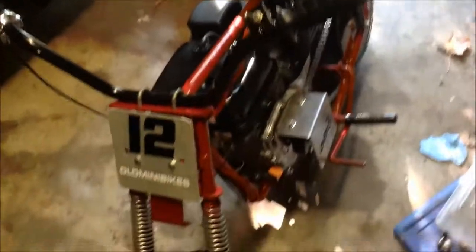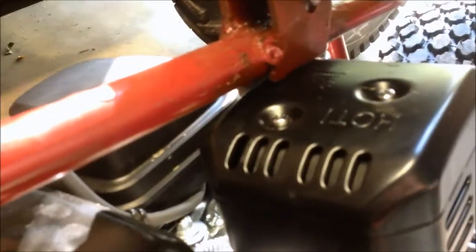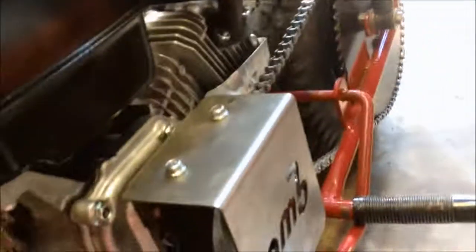For pulling this frame out of the junkyard, it looks pretty good. I unhooked the low oil sensor so I don't have a problem with it rocking around, because normally on hilly terrain it would shut the engine off thinking it's out of oil with the oil sloshing around. Another thing that's annoying — I had my new muffler on, but the other one was a straight pipe and it won't fit because it comes out of that side of the overhead valve. So I'm going to have to order a straight pipe that will fit and go out the rear, because this muffler is so annoying — I've burnt my arm on it like three times. So that's got to be fixed next.